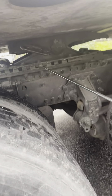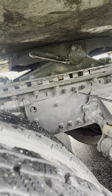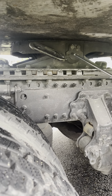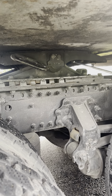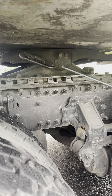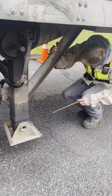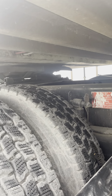Now the fifth wheel. The platform base is securely mounted to the frame. It is not cracked, broken, or damaged. This skid plate is securely mounted to the platform base. It is not cracked, broken, or damaged. All the bolts and pins are secure and not missing. The apron is not bent, cracked, or damaged, and it is lying flat on the skid plate. There is no space between the skid plate and the apron, and they are greased properly. The release arm is secure and locked, and the locking jaw is locked around the shank of the kingpin. The kingpin is not damaged.